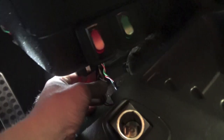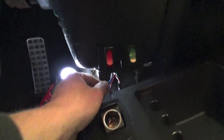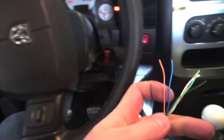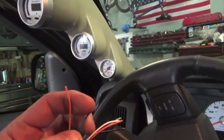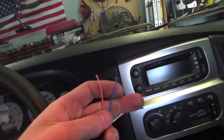After you figure out wherever you ran your wiring to, you are going to be finding this white wire out of your AEM wide band gauge that comes down with your positive and negative wire. We are going to be hooking this white wire up to our adapter cable for our SCT3200 programmer. The two wires we are looking for are the orange and blue ones. Orange is going to hook up to the white wire coming out of the wide band itself, and then the blue wire is going to go straight to ground. I am going to use the ground from the wide band too, so we don't get mixed signals from different grounds.